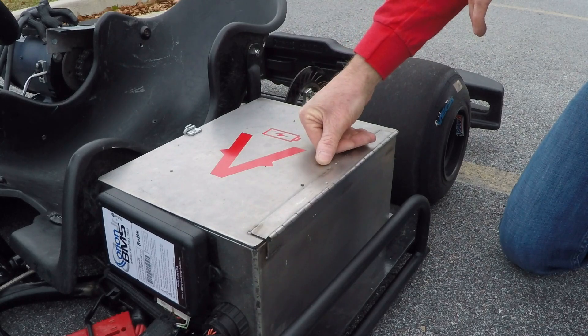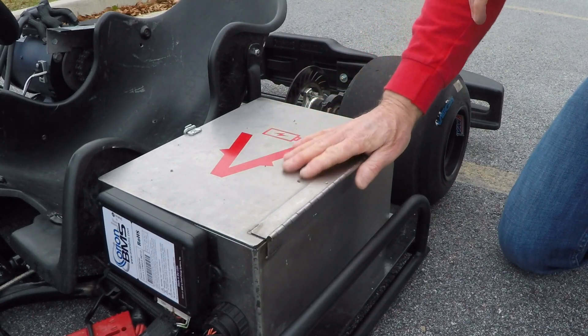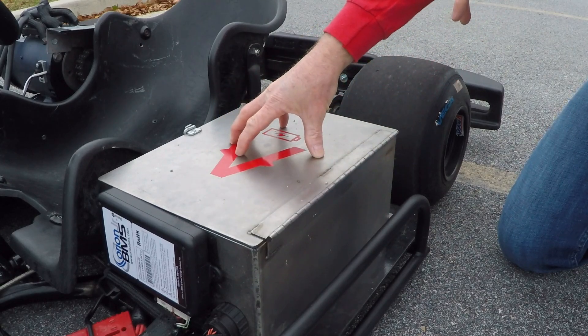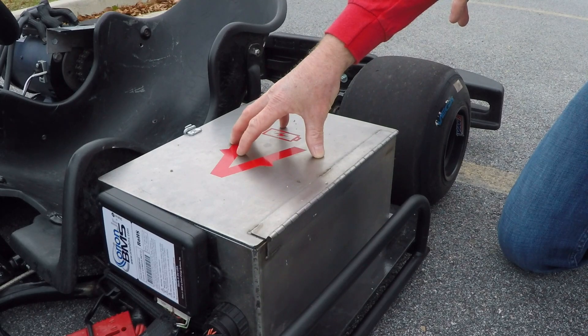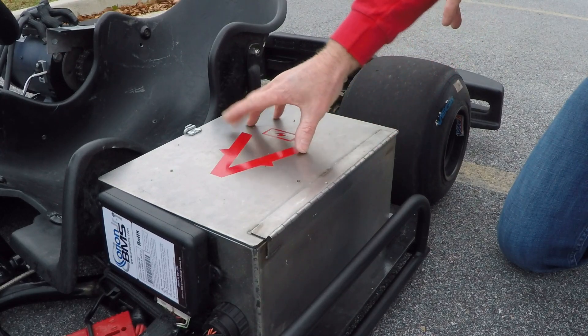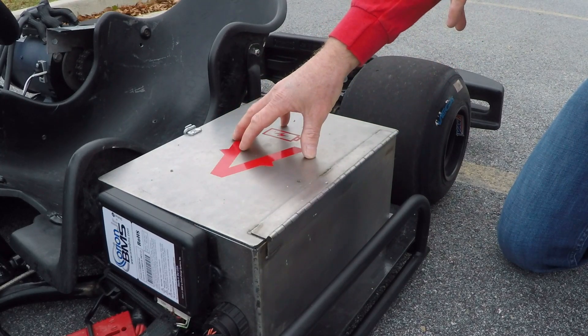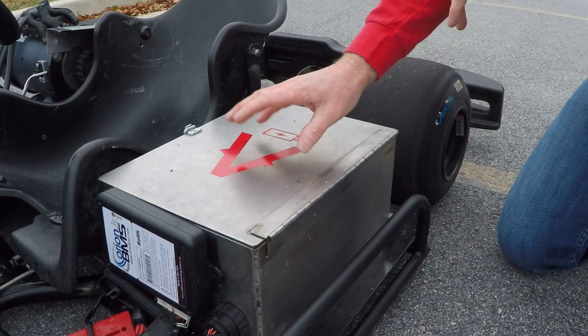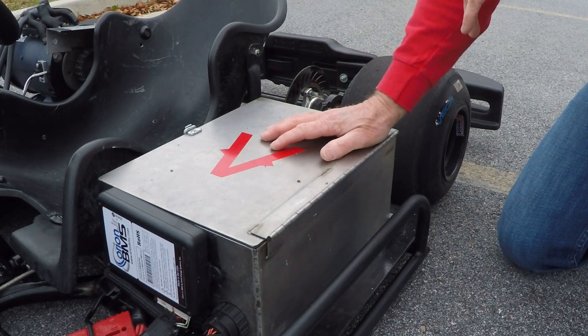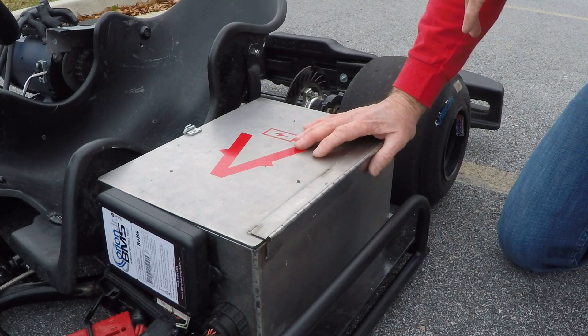This is the third major component of our bolt-on kit — the lithium-ion battery pack that will come with the kit going on sale next spring. Inside the metal casing are modules containing lithium-ion cells, very similar to what Tesla uses in their electric vehicles. Tesla actually uses Panasonic cells; we are using LG cells. But in both cases these are referred to as 18650 lithium-ion cells — a very high energy density lithium-ion battery that will allow us to deliver the amount of current we need for this application.